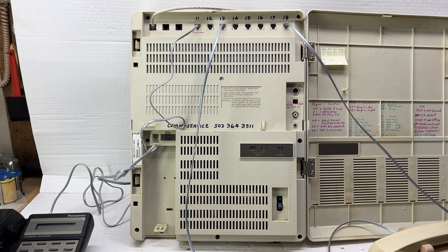You can call between the stations by dialing the extension numbers of whatever the jack is and it'll ring a standard 500 or 2500 phone, or you can have a proprietary phone. When I was selling and installing these systems it was not uncommon to have a fax machine set up on a jack, and you can program that jack for what is called pickup dial — so when you go off hook and wait three seconds it dials 9 automatically, or whatever trunk code you chose. So you don't need to dial an access code on a fax if you didn't want to.